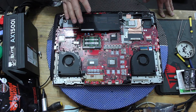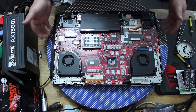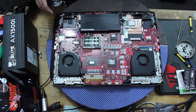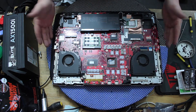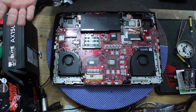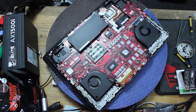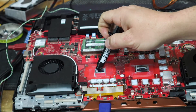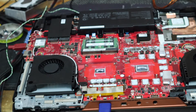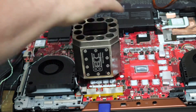The biggest problem I'm facing right now is that in order to mount the copper pots onto the two devices I need to be able to switch the notebook on. To switch the G703 on there's a power switch around here, so I'm going to lift everything up, flip the screen open and have the screen hanging off the edge of the desk so I can access the power button. Using Thermal Grizzly Cryonaut on both the processor and the video card, we're just going to get the pots in position.